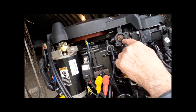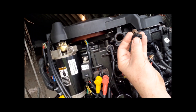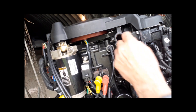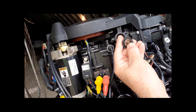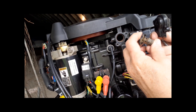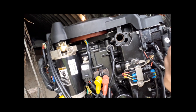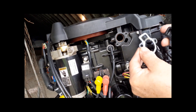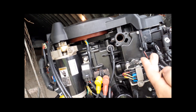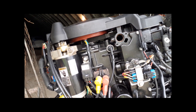Oh, that's interesting — the gasket around this thermostat is buggered up. Look at that, it's rolled and it's rusty. Whether that means anything or not, that was wrong from the beginning. This gasket looks nice but I'm taking it off and we'll change it.